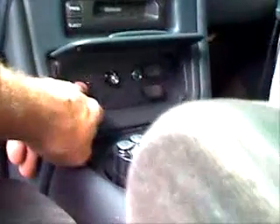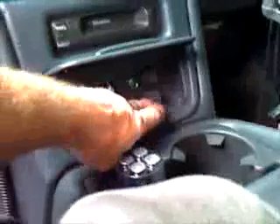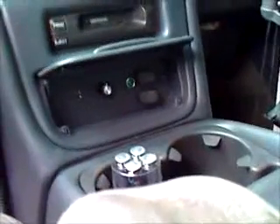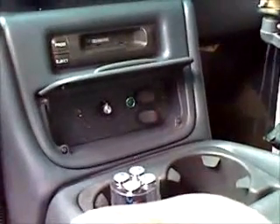As far as the controls for the oxygen sensor and the MAP sensor, they're located down here — this used to hold cassette tapes and I've built a little block-off plate. This is what brings on the oxygen enhancer, and this adjusts the signal to it. The green light tells me the unit's on. This is the primary switch to bring on the reactor, and this is the switch that powers the pump if the reactor draws too much electricity or gets too hot. That's pretty much where I'm at with this — I'll keep you posted on how things go.